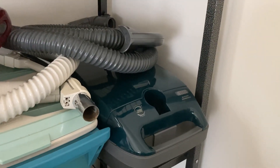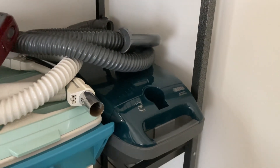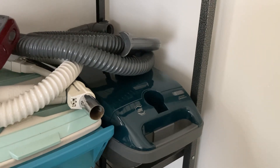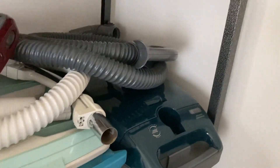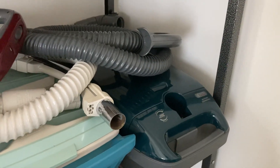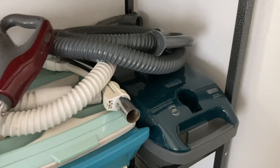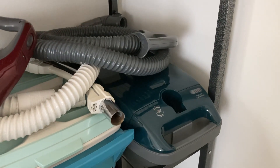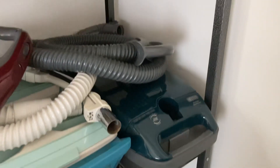This Kenmore I got from Goodwill a couple of months ago. It's a Whispertone made in 1999. I bought it originally to resell, but I saw how good a shape it was in — it's hard to find these in good shape because they were used and abused. This machine still has the old-style Ametek motor before they went to the Panasonic motors, so it sounds a little different. The powerhead doesn't have replaceable brush strips or beater bars like the earlier Whispertones, so they cheapened it out a bit. There was almost no dust in the motor housing, indicating it wasn't used a lot. A nice find for only $5.